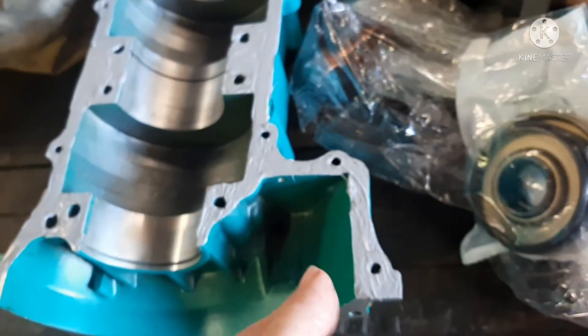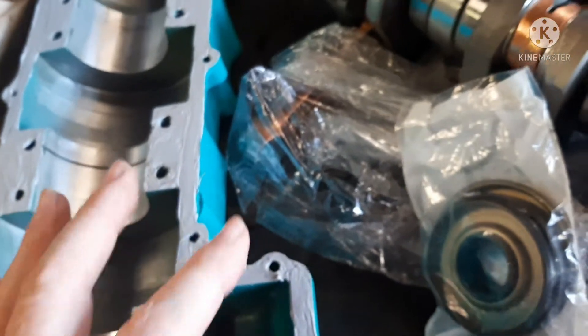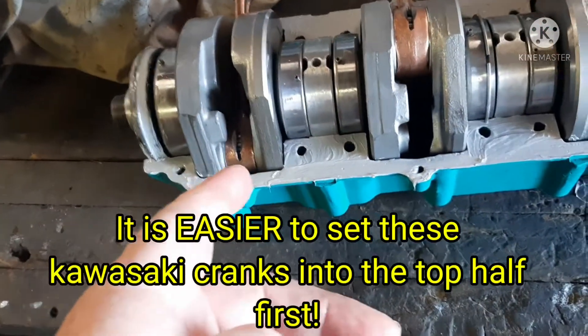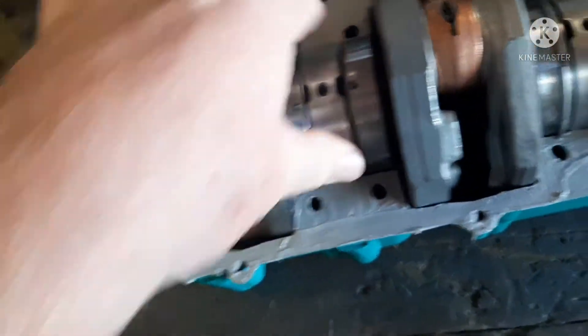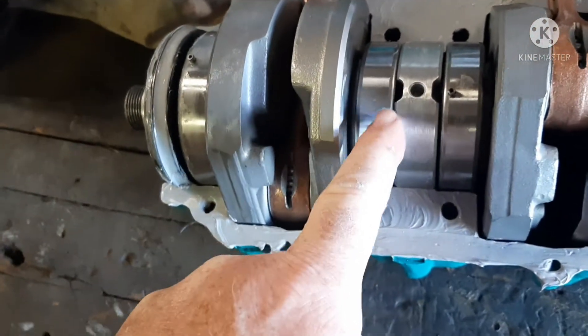Let me get my seals because I've already got this stuff curing on me. It hasn't got real tacky yet, but I'll get this crankshaft seated down in here. My crankshaft is set, all these are up. I've got to leave these centered — these collars. This one's off a little; it's got to go that way. These have got to come down to one side.